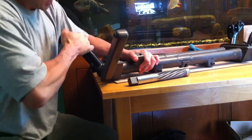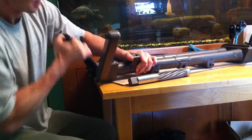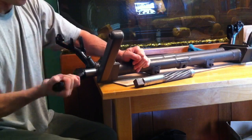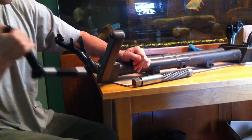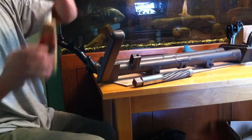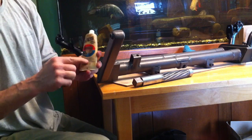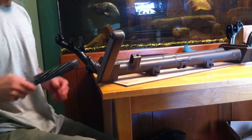This is really tight — I can hardly get it out of here. I put a little Vaseline on there, but I've heard that's not recommended because of the petroleum base of the grease. So I switched to this other stuff called Silglide. Silglide is silicone-based, and it says it's safe for rubber and plastic. This is a really old dirty one, but I use that now.